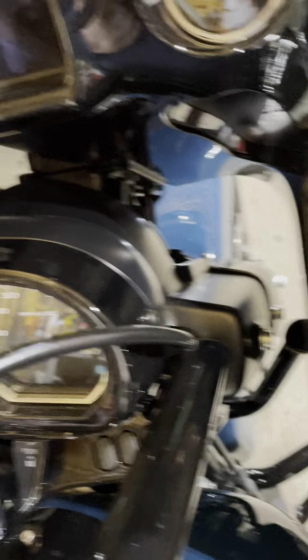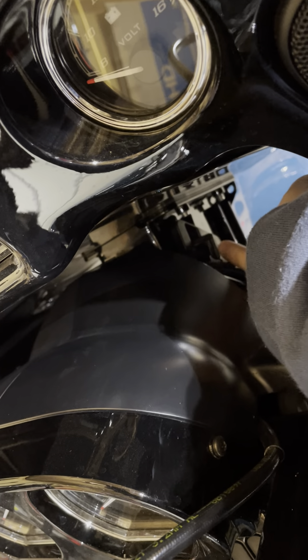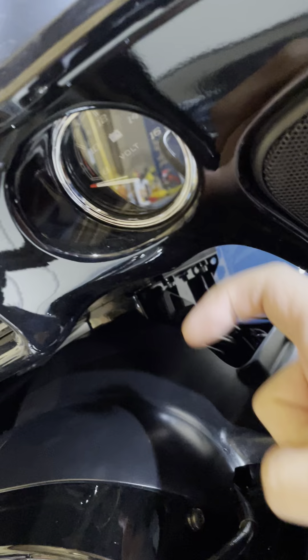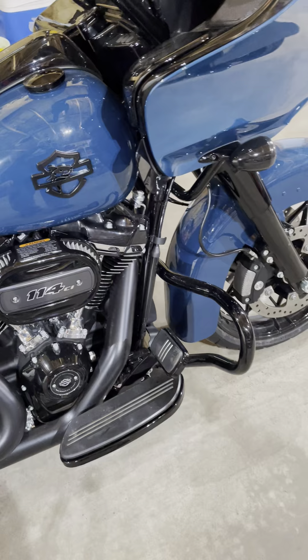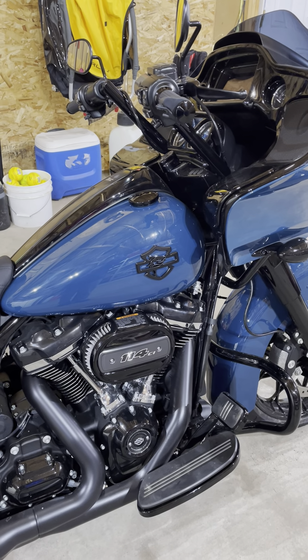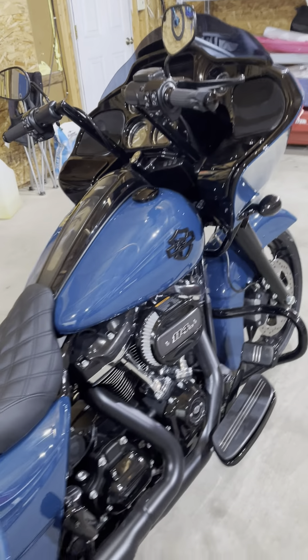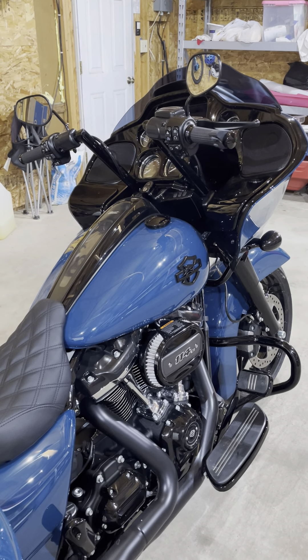It's right here — this little thing. So this is my clutch line and it's running up underneath this little U-shaped hook. Make sure you run it back through there. You just have to loosen your clutch when you do it — this part slides up and there's your clutch. There are other YouTube videos for that detail, but I'll do a full install video when I get my other bars.